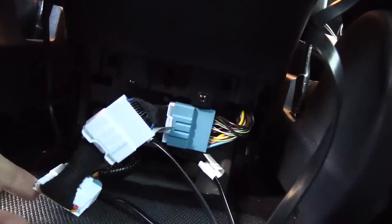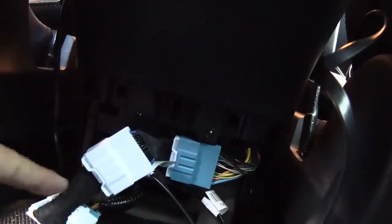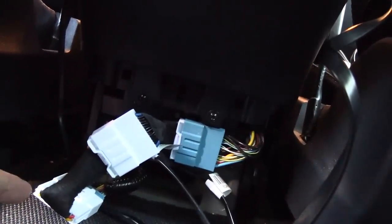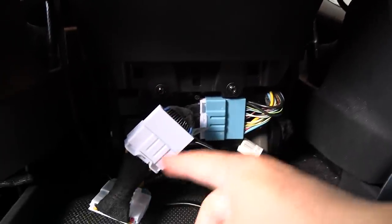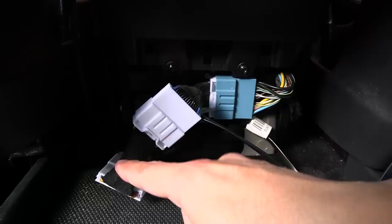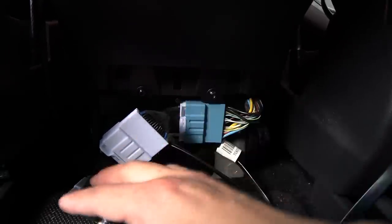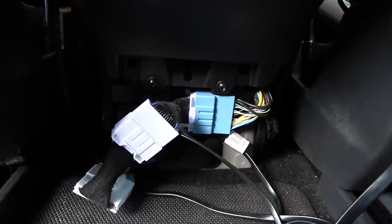Another important thing to show you is how it's connected in the back. If you've seen ScanMyTesla and similar tools, the OBD CAN bus port is here. What you do is attach this extra adapter that runs in parallel and taps into info like speed, state of charge, and so on. You can actually put two in series — that's what we did so we could get both of them hooked up. That also means I can hook up the head-up display and still use my ScanMyTesla adapter at the same time.